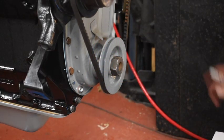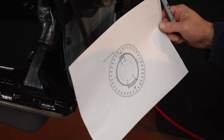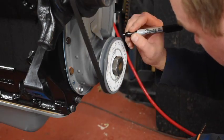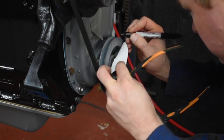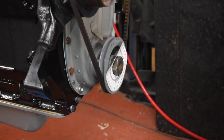I'm just about ready to go, but while it's still on the stand and it's a slightly more accessible height, I'm just going to mark up the pulley a little bit. I'm going to be able to set it up as per the manual, which uses the adjustment on the distributor. I've got a vernier distributor for this car, but this is going to let me go have a look with the timing light and have an idea where I am.